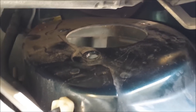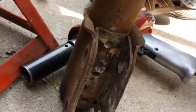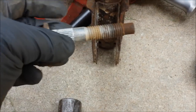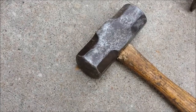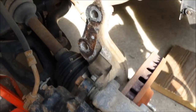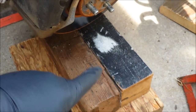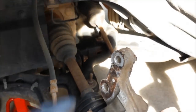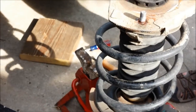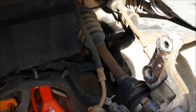I got the three bolts off. Then there were the two bolts down here on the bottom right there — they were put in there like this. The bolts came out pretty easy with this little mini sledgehammer here. They kind of pulled out and once it came out, we put blocks of wood under here to hold it up off the ground so this thing wouldn't fall and break anything. When it broke loose, you need to make sure you have somebody holding on to the springs because this thing falls and could potentially break your brake line, which would be bad.